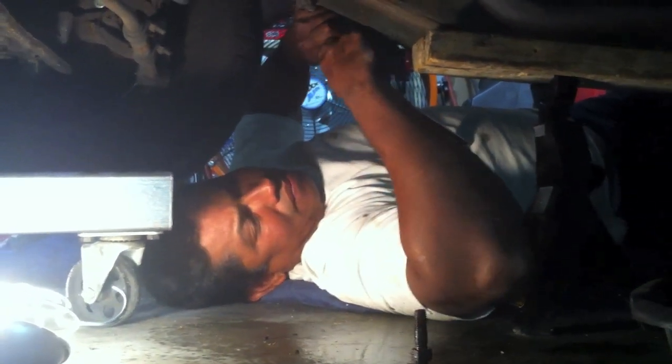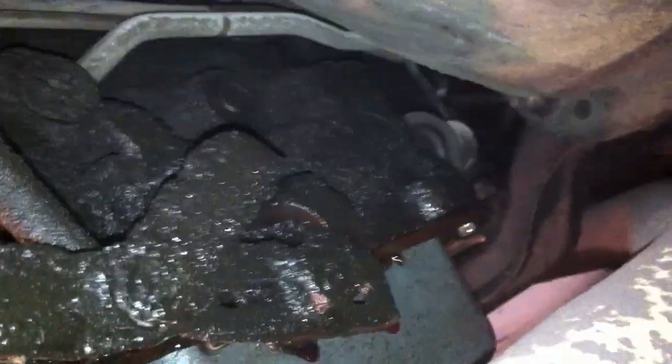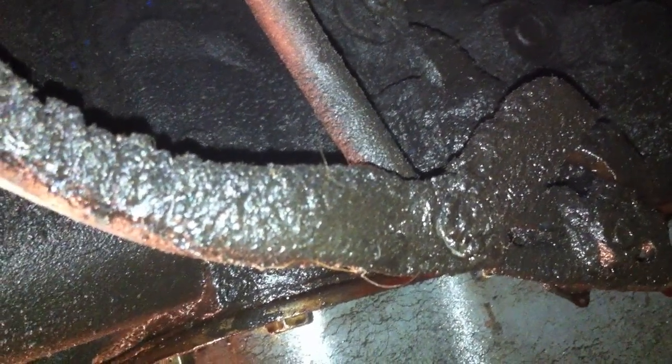Here is the crud on the kick-down bar that comes down and connects to the trans. She's leaking a lot down here — this trans is all wet. It's a good thing we planned on redoing this trans. It's been leaking for a long period of time, and road dirt has built up on her. There's the extreme Mustang Medic close-up of where the kick-down connects. Now I'm taking off the bolts — they're all loosened up.